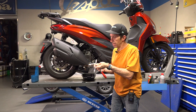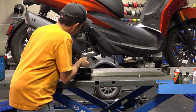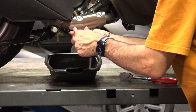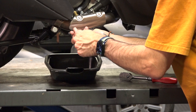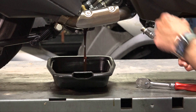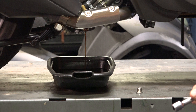I have an 8mm Allen key in a three-eighths drive wrench, which makes it a little easier — you could also use a basic L-shaped Allen key. On the right-hand side, right below this bolt is the fastener for the oil drain. Just break it free and be prepared for oil to start coming out. Go ahead and tip that drain plug out of the way. The drain crush washer dropped into the oil — that's fine, just make sure you don't end up with two of them. Allow the oil to drain. You can see how fast it drains since it's warm. Next we'll move to the rear of the engine and drop the gearbox oil.